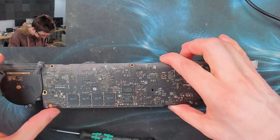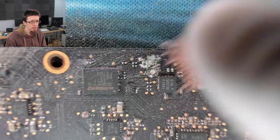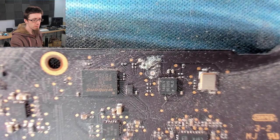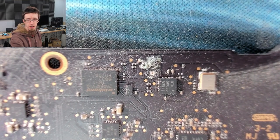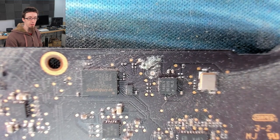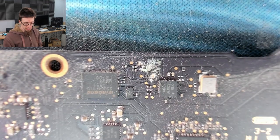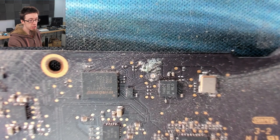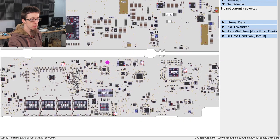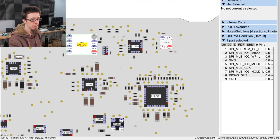Interesting. Before we do anything else, let's take a quick look at what that is. Can I wipe that without removing it entirely? I want to see what that is before I clear it off. That Winbond chip — that's the UEFI chip, our BIOS chip. I'm going to open up the schematics for this and take a look at what those circuits are doing, because that will give me an idea of whether this is likely to be the cause of the fault. This board is 820-00165. Switching over to the board view and schematics in Flex Board View — that is the chip, U6100.